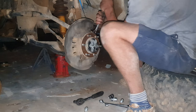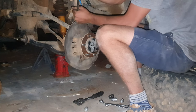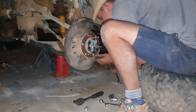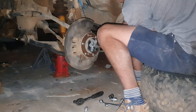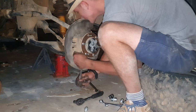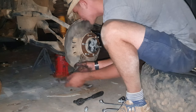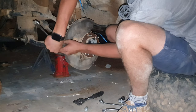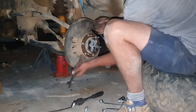And why hook them together? It gives you more leverage. So we're just going to loosen all the bolts quickly. Okay? And if you don't know what leverage is, don't worry about it. Just know if you hook two spanners together like I showed you, I'll show you again like this, you have more power too. And if you just heave it a little, it comes loose.